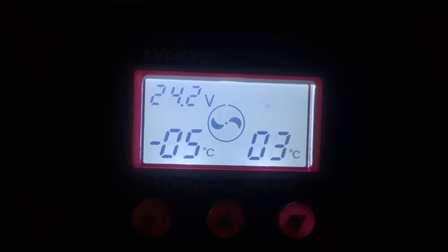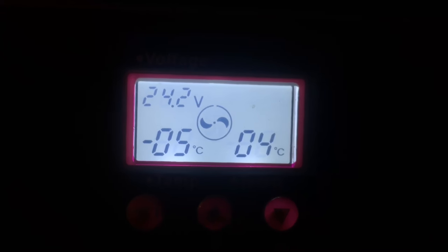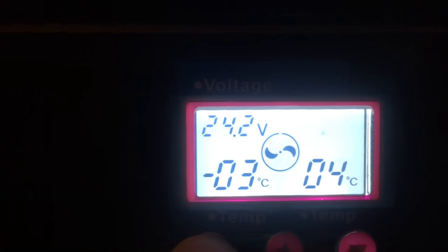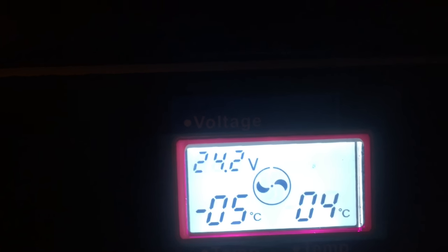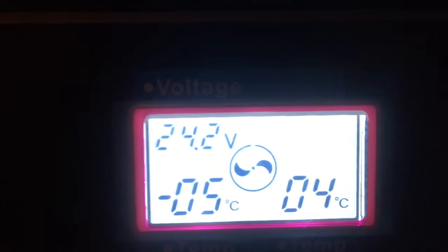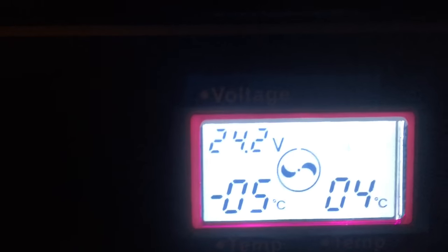It shows it being set to 24 volts. I've plugged it into the mains, so this is 110 voltage coming in. When I'm on the road this will be set to 12 volts with a cigar lighter. With this button I can set the left-side temperature. The right side — the fridge — is set to 2 degrees, and currently it's up at 4 degrees. If I press and hold the set button you can see the voltage. Right now it sees 24.2 volts. The default cutoff is 21 volts, at which point it will turn itself off. On 12 volts, it's currently set to cut off at 10.8 volts.